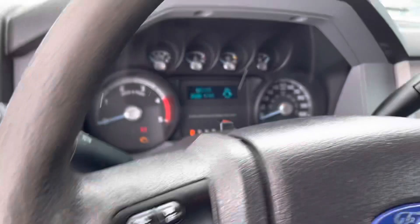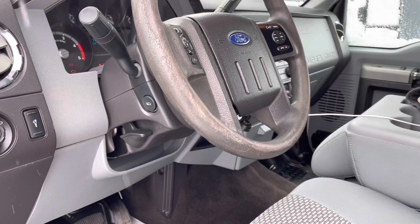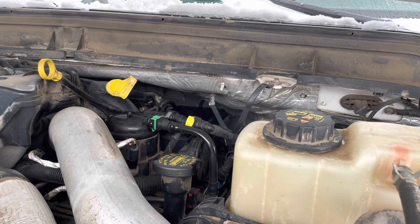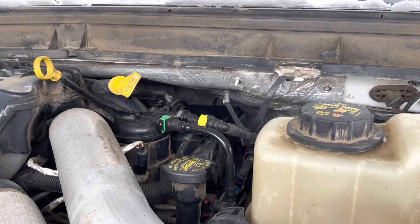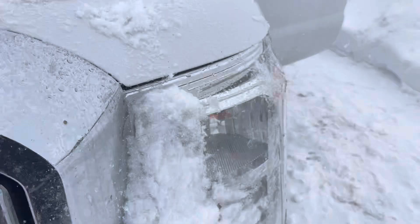The first two charges I heard that pumping as it's pulling fuel back into the system. I'm guessing it won't do that on the next four, but that's what the mechanic in another video said to do. You can hear it pumping again on the third — seems like a computerized thing, which is why he says to keep the key clicked over for 30 seconds at a pop, six times. I came in to double-check for any fuel leaks — there are none — so I'm going to go ahead and start her.